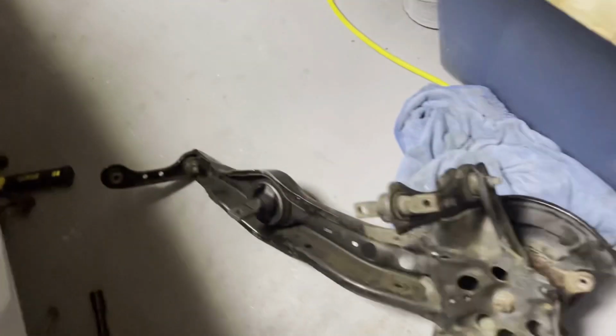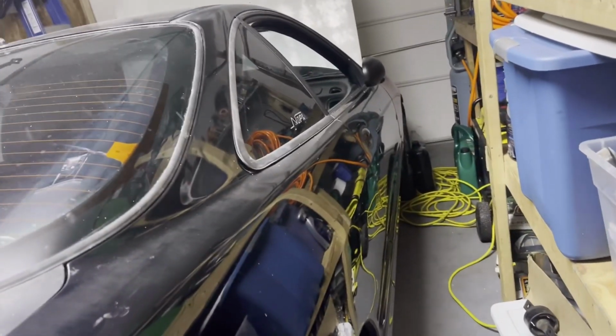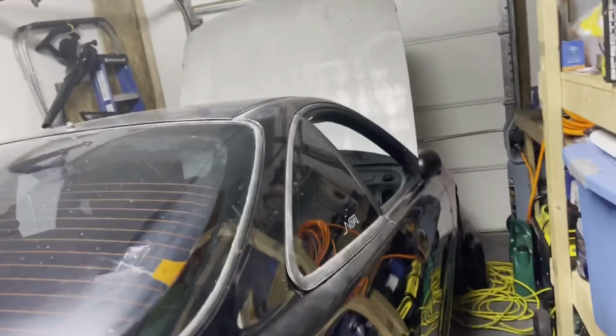And then we had to take the wheel sensor down right there. There's just the two 10 millimeter bolts on the other side here, which sits in this little casing right inside here, and it bolts up. So, all right, we're going to get ready, put this back up and lower it down. Make sure the other side is good to go. And then we'll start it up and pull it out. And then we'll hook up the third brake light. We got the battery tray done and the battery bracket, so that's done. So these are the three things that need to be done to pass inspection. So let's do it. Let's get it in.